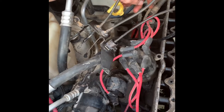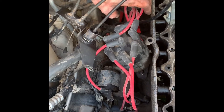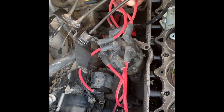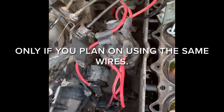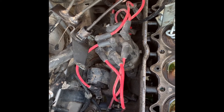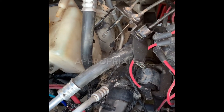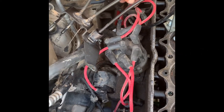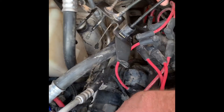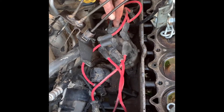In this video we're going to show you how to properly remove a distributor rotor, the rotor cap, and spark plug wires. One thing I would recommend before you get to this point: when the spark plug wires are plugged in and the spark plugs are in the engine, tag them one through six. That way when you have all these wires loose, you know that six plugs in over here, five, four, three, two, one — just to alleviate any confusion.